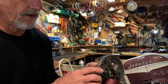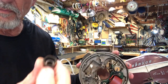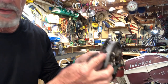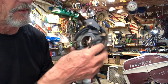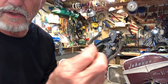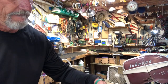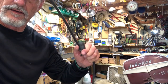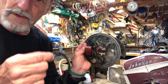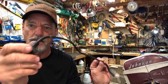All right, so to take the spark plug wire off, I'll remove the boot. It goes down inside the hole right here. To do the other side, you gotta disconnect these two pieces to get it out. This one we can slip back in the way we took it out. All right, so I've got the wire here. I'll pull it out of its routing clamp. Okay, we'll save that magneto on the side.